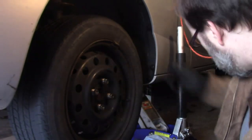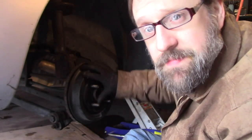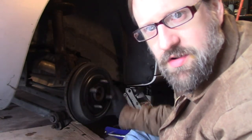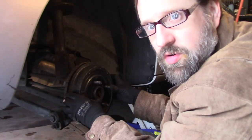We're going to take off the wheel. The next thing that you want to do is make sure that you don't have your emergency brake on, which you'll be able to tell. If the wheel spins, the emergency brake is most likely not on, unless there's something really wrong with your emergency brake, in which case you have other issues. This is a front-wheel drive vehicle, so there's no drivetrain to lock this up. Then you pull the drum off,